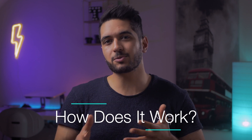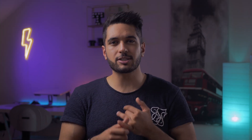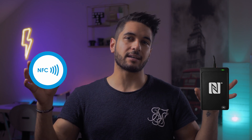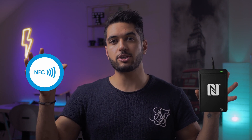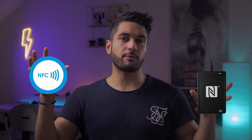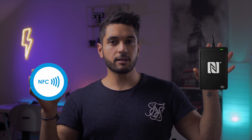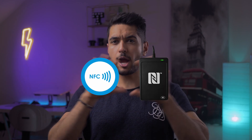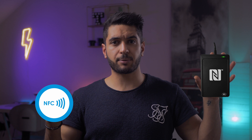So how does this work? To start with, the technology is called NFC or near field communication. The basics of this tech is that you have an NFC reader and an NFC tag that stores all the information and requires no power whatsoever. Then you need to have the reader to read the information from the tag. There's no pairing process whatsoever — all you need to do is tap your phone to the NFC tag and the task you want is triggered.